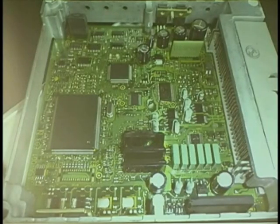I know this is an IC chip, and it's a driver circuit. So you've got to say to yourself, something burnt it out, because if you put one of these in, it's a very expensive fuse. Very expensive. So you have to start checking devices the computer is going to ground, driver circuits. You have to take a list and find out whether it's injector drivers, not coil drivers. You're not going to sit there and ground a coil and check how much current it is. But injector drivers, solenoid drivers, relay drivers, make sure nothing is low enough to create high current, because that's what took it out.